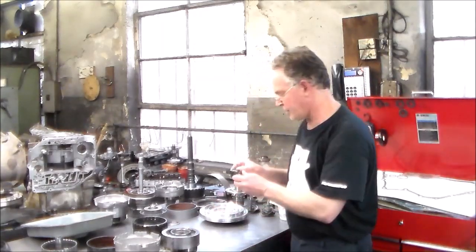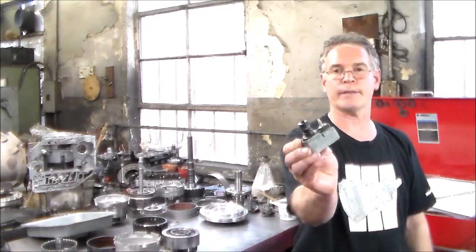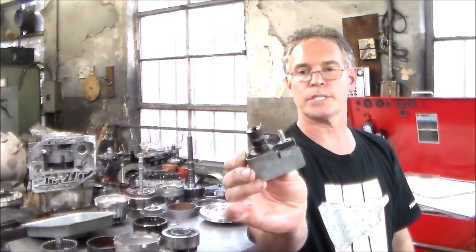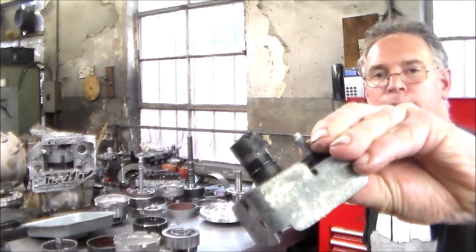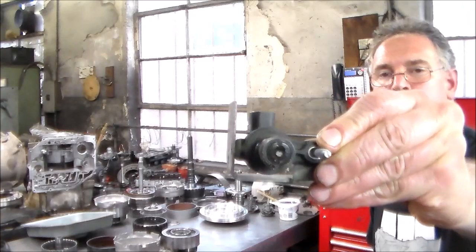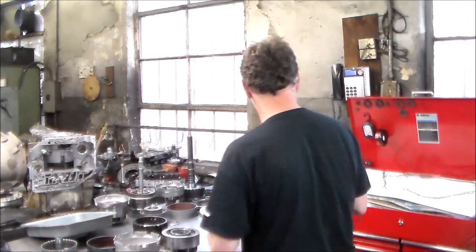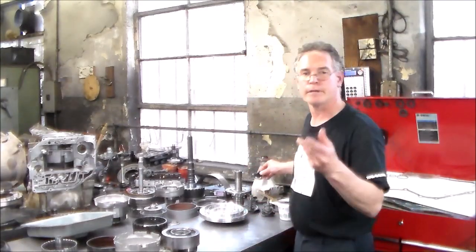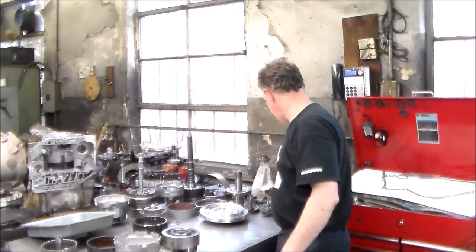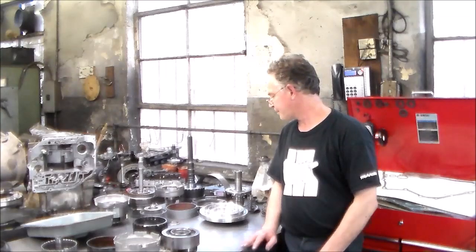All right, so when I took the input speed sensor out that they added in 2004 and up, you can see the crap on the magnet here, which again isn't that bad, but that's usually a sign that we have something broken in this transmission. It's absolutely pouring out, by the way. I started to do the intro, I saw the dark cloud coming out, forget it, pouring.